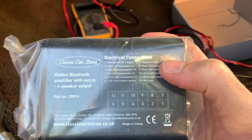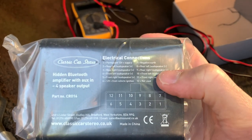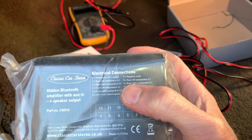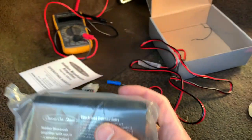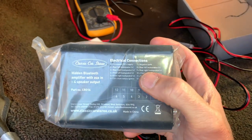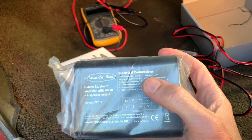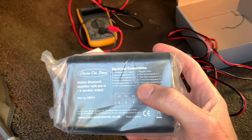After some discussion on v8buick.com we were looking at running a new power supply from the starter, creating a new bus, but after looking around the car more and referring to the workshop manual I've found a much easier solution. Unusually, my Riviera doesn't have power windows, and as a result there are no rear cigarette lighters. The connector for the rear lighters however is present at the front of the car and is currently unused. Let's look at the wiring layout under the dash to get a better idea of what's going on.